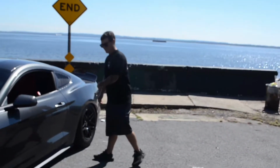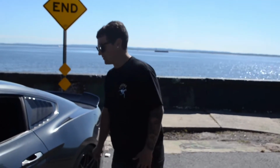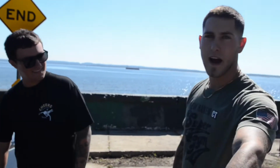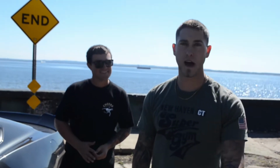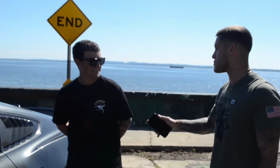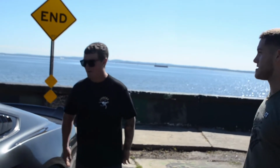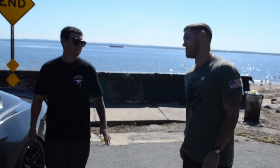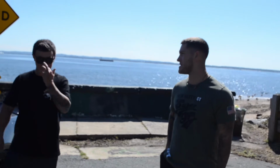Well, for underneath, transmission, we got a Ben Callimer Stage 1 TR6060 out of a 2012 Shelby GT500. Which, by the way, I drove for the first time today, and it was not easy. I just stalled reversing, and now I know why people high rev on race cars so much on reversing. Yeah, it's hard. It's a heavy clutch. But it's meant for 1200 horsepower. So not that I'd ever go that much, but still, you never know.